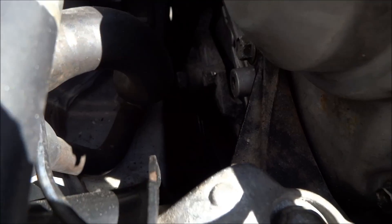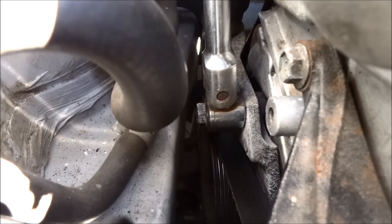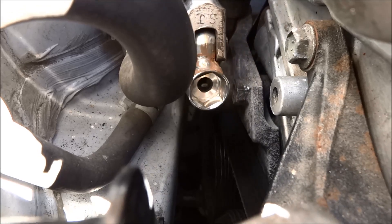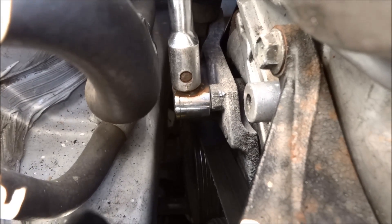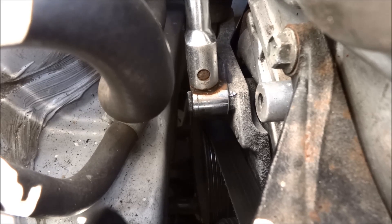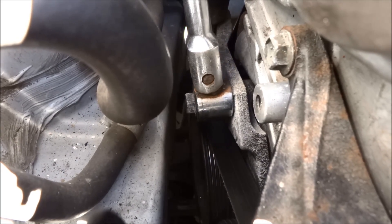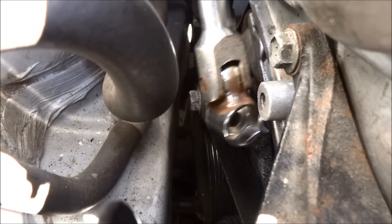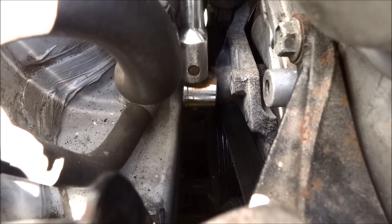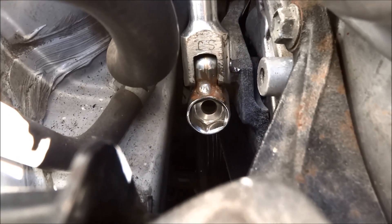Down in there is the belt tensioner. I made this tool out of an old half-inch breaker bar and a three-quarter six-point socket, because you can see how somebody used a twelve-point that slips — it's a cast part and it's not exactly 19-millimeter, so if you try to use a twelve-point it slips. Anyway, just wanted to show you that because it's a real pain on Toyotas. If you do very many of them, making that tool helps because there's not really enough clearance for a half-inch breaker bar. It works but it's not easy. I recommend a six-point.